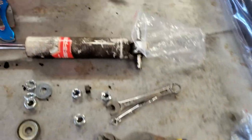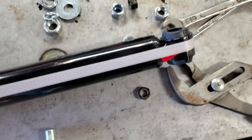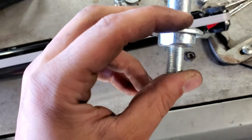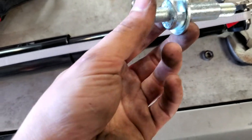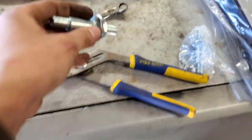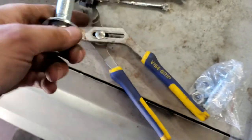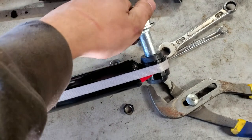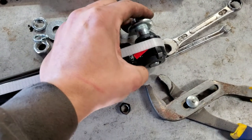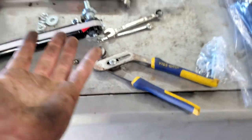So here are the new rear shocks. That is your rear shock — this goes on top, this goes on bottom. So that rubber bit, your bushing — don't know the technical term — that would be your mount. This goes into your control arm, or axle in this case. That would go on the bottom, it would mount in like so. Then you put your bolt on and that's fixed, that's solid, that's tight. Then you slide the shock over it, get it all the way through, and then you put your washer and nut on it. That's how you properly do this, because that's how it's designed.